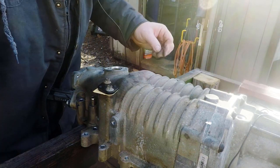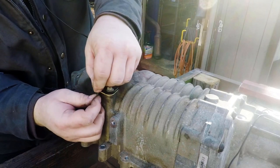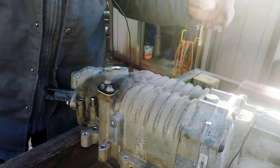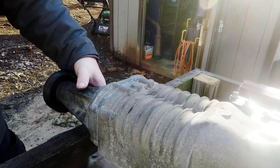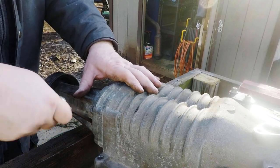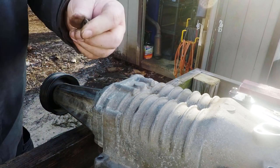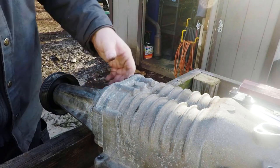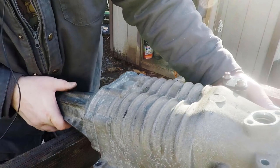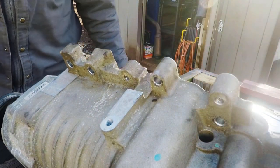For appearance purposes I'm going to go back behind this and cut the excess gasket off — you don't have to do this, it's not going to hurt anything, I just think it looks a lot better. And there you go, that's the PCV valve done. So the next thing we're going to do is change the supercharger oil and change the coupler. First thing is to pull the fluid plug out right here — be careful with that little O-ring, you want to make sure you keep that. You're going to be looking at a 3/16th Allen. Then I put a pan down under this, flip this sideways and dump the fluid out. You can actually just sit it up like this and it should just drain all by itself.